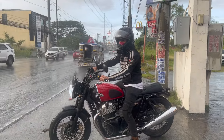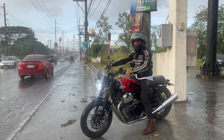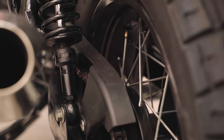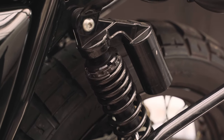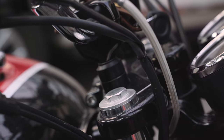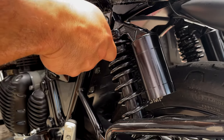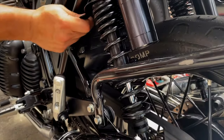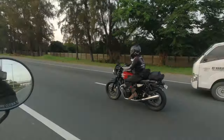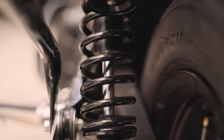This resulted in a weird jittery ride and kind of a feeling of being on a pseudo-cruiser. To solve this, while still enjoying the adjustability and performance of the lowering shocks, I installed the fork extender that comes inside the box of the lowering shocks, significantly raising the height of the bike past stock. I suspect many people who install aftermarket shocks neither tune them properly nor take into account how a change in seat height changes the bike's geometry. I got an expert mechanic to tune the rear shock and he added a significant amount of preload — it was previously set to the minimum, resulting in a weird bouncy ride. The effect was night and day in terms of ride smoothness. It glides on the road now, and you can actually really feel this as a pillion. However, he still tells me the spring is for a heavier rider and I would benefit from a lighter spring.